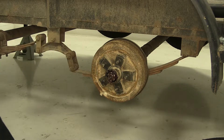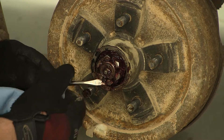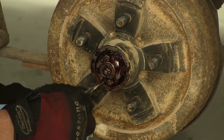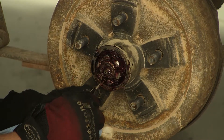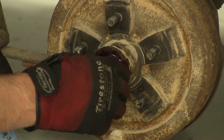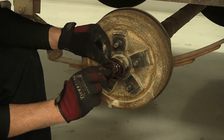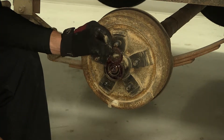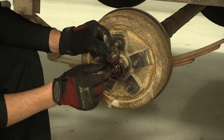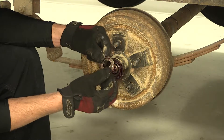The castle nut is what holds the outer hub assembly together on the axle. For this style castle nut, the keeper is a metal tab that is bent over from the washer that is actually secured underneath it. We'll flatten out the tab of the keeper and then we can remove the nut. Here's our washer that goes between the keeper and the outer bearing, and here's the keeper and the metal tab that we had to straighten in order to get our castle nut off.